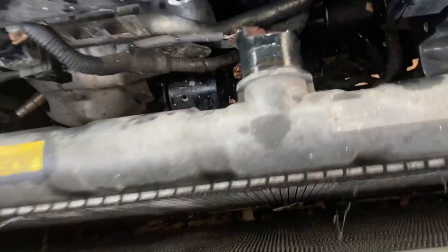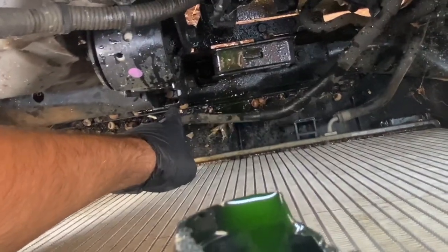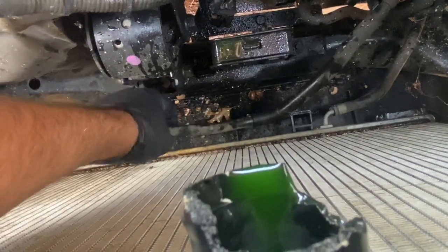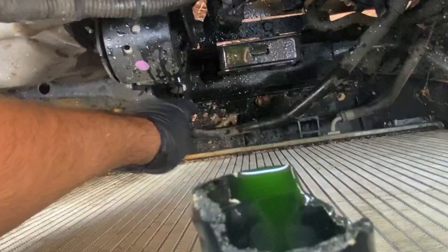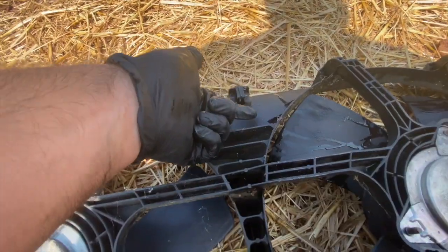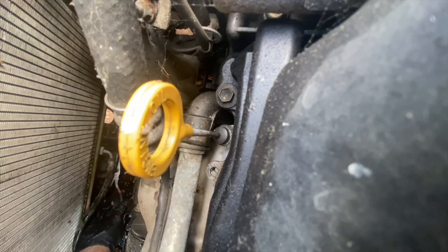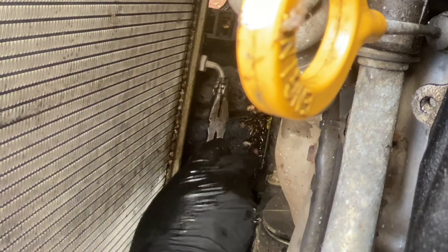One thing was holding the cooling fan, it was this line. This is a transmission cooling line. Make sure when you remove them, you put them back in the same order. But this one is longer, you can't mix that. But this is inside the cooling fan. Make sure to remove them. It goes right there, slide it out. Use the smaller tools. Yep.